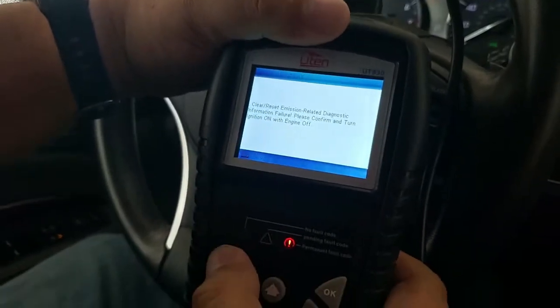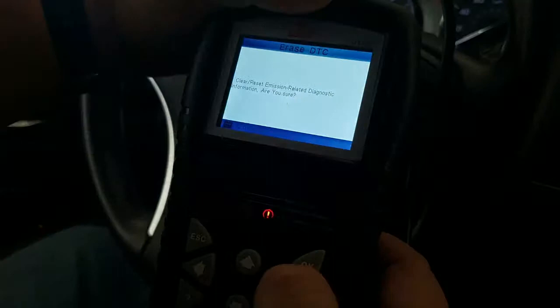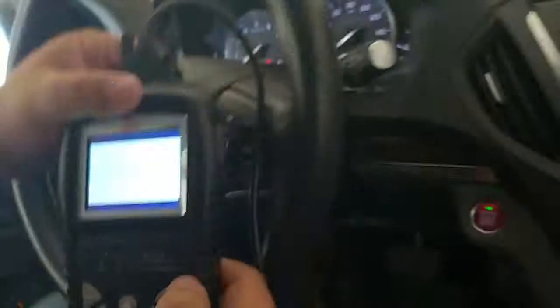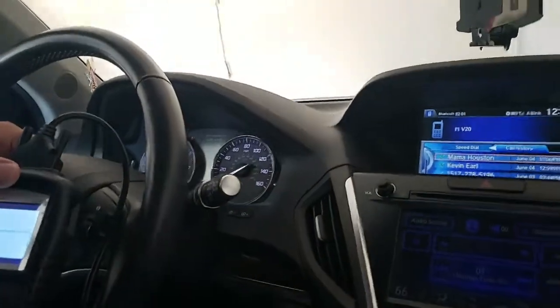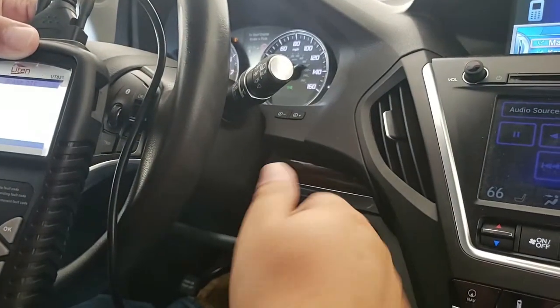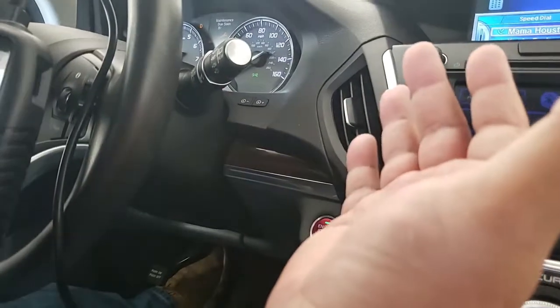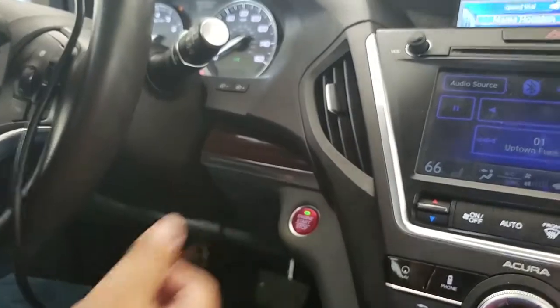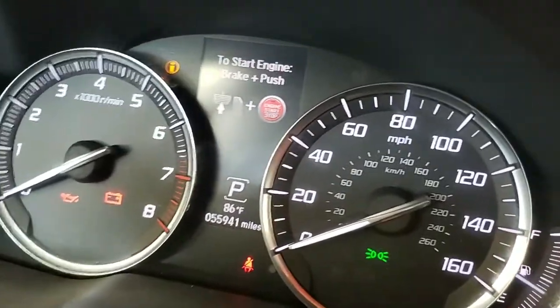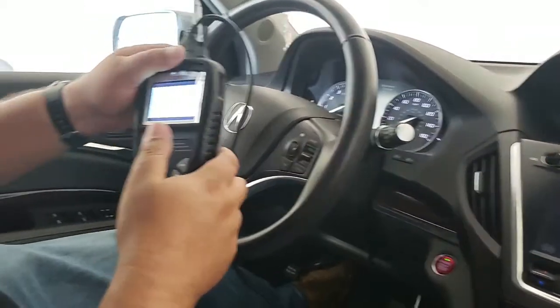I'll try it again — Erase Codes. It says it has been cleared. So the key is to not have your engine running but have it in ignition mode. If you had a regular key, the first position is accessories, the next is ignition which turns on your vehicle systems — you can tell even the AC kicked in. In accessory mode only the radio and front panels come on. And you can tell you no longer have that maintenance light — that's because we need to change the oil — but you don't see the engine or emissions warning anymore. So I guess it does work.